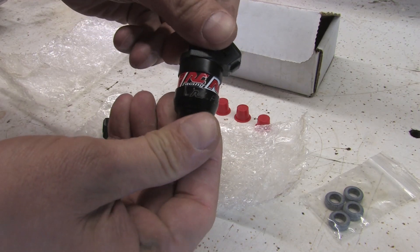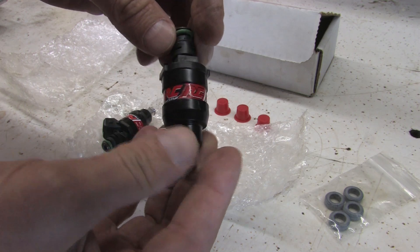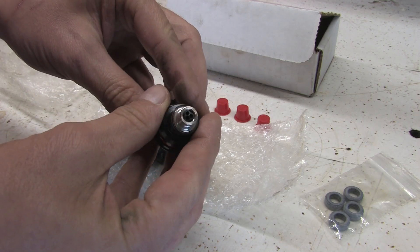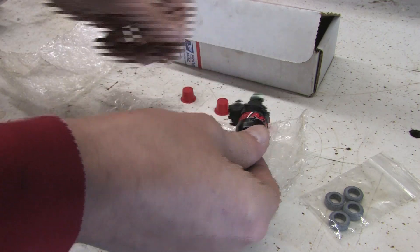These are RC model PL4 750s — low-impedance, peak-hold type injectors. Mitsubishis use low-impedance injectors, just remember that. These have a 3-hole diffuser in front of a ball-and-disc-style injector nozzle, which helps diffuse the fuel spray to increase atomization with the passing air.